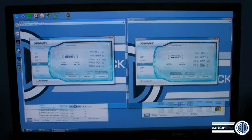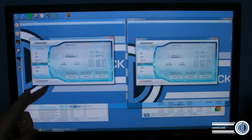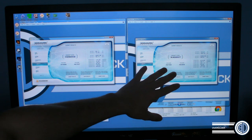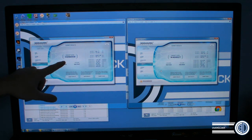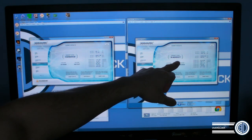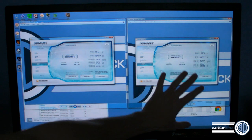Right, here, again, this is quite an impressive one, really. It's the P score, generally, it will have a much bigger gap. We've actually still got a 12,000 point gap. Now, obviously, you can see this is 28,259. If we were to overclock the Titan in this, as I've shown you previously, it does close the gap a fair bit. These are pre-overclocked anyway, don't forget, running at 1100 megahertz. With the Titan, we can actually get 31,500. So that closes the gap a fair old whack. And again, it's still, yes, you are looking at a 25% performance increase, benchmark for benchmark.